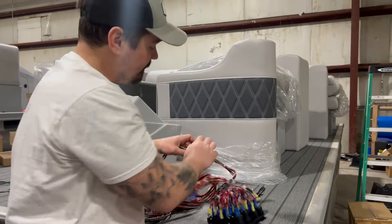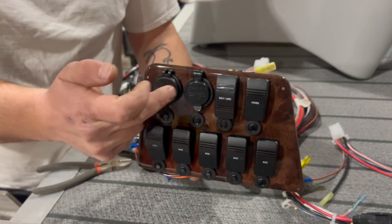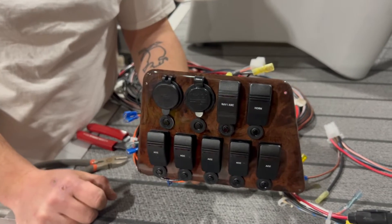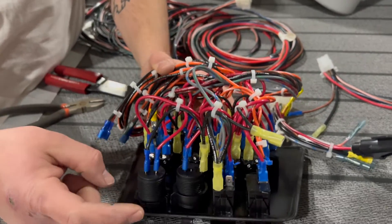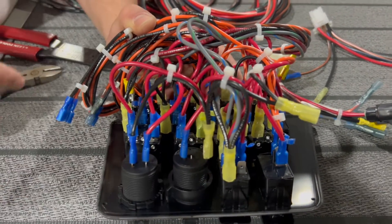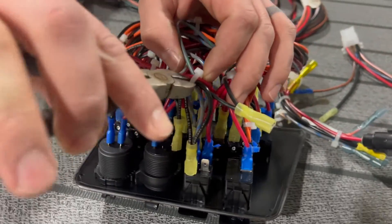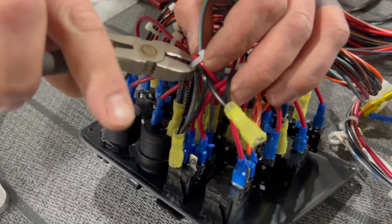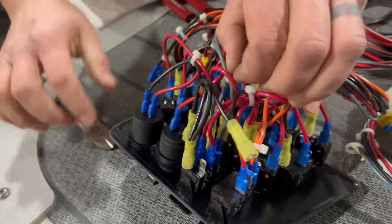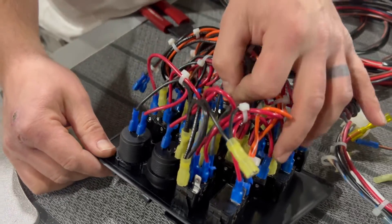Safety third. Let's go ahead and unhook our power source. So this is the top of the switch panel. On the back side, this is my USB charger and this is that 12 volt outlet. What I'm going to do just to make things easier to move around is clip this zip tie - it's not doing anything special, it's just holding things together - and that's going to free up this bundle of wire so I can move things around easier.